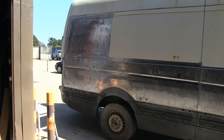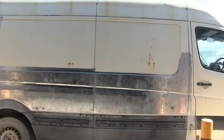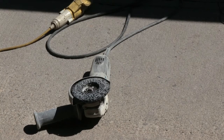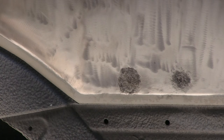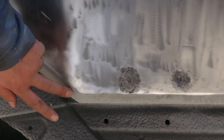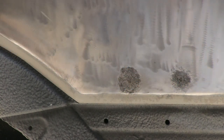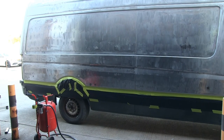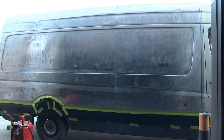At this stage I started removing the paint from the rest of the van's side panel. It's a slow process, but I decided it was better to do it because underneath the paint there were millions of rock chips and damage. I used a disc on a grinder to take everything off, though I don't think it was the best choice — the friction from the disc created some distortion on the very large panels, so I had to fill quite a lot more. Now you can see the paint is knocked off and I'm pretty much ready for shot blasting.